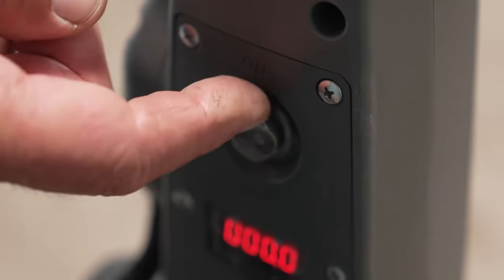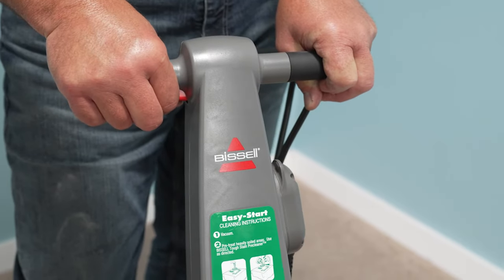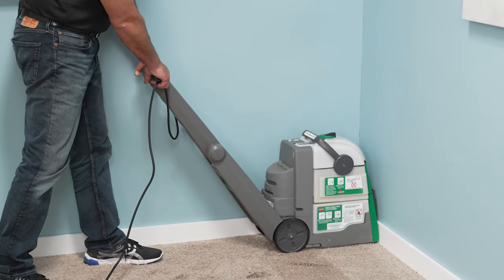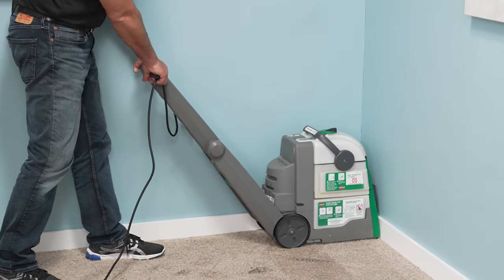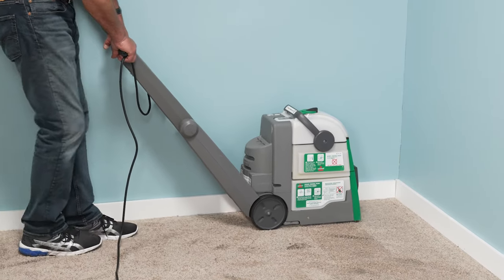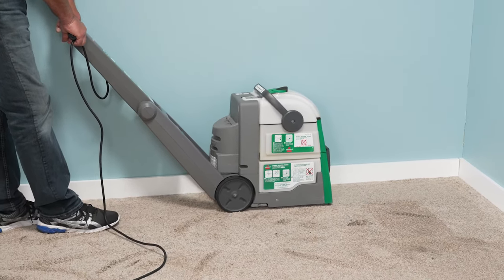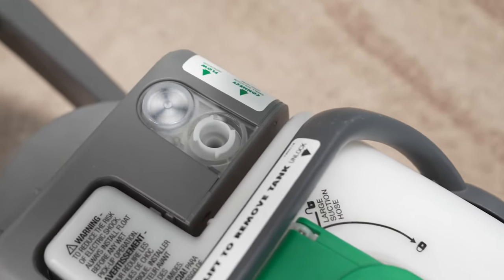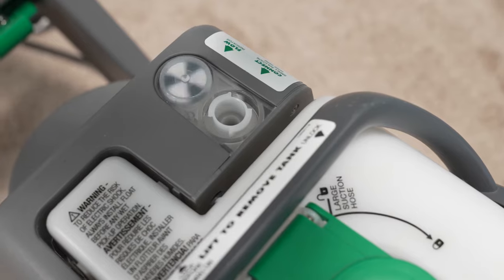Right on the back there is a power button, and there's a red button that you pull with your right hand that activates the solution and the scrubbing brush. You pull that and pull the machine back with you. Slowly move the machine backwards and you'll see that it's applying the solution and scrubbing the carpeting. That spinning wheel is called the flow indicator. When you pull the red trigger that applies the solution, this lets you know that the clean water tank is full. When that stops spinning, it's time for you to refill that clean water tank.